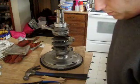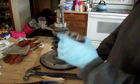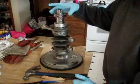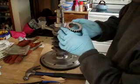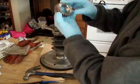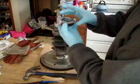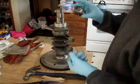And the two gears unfortunately can only be put on after being heated up. If you just try to put them on right now, they won't fit. So you heat them up, and typically they drop on real good. Pay attention to the two dots on the top of the gear, so you have them facing upward. You don't want to have them on the wrong side.